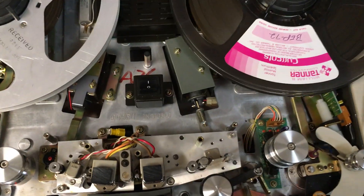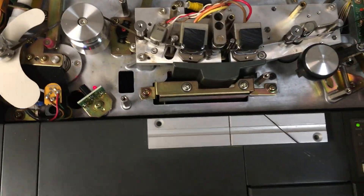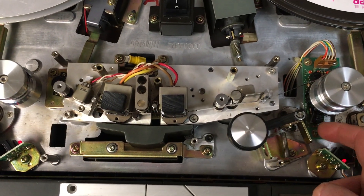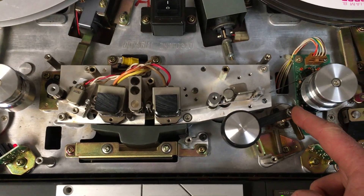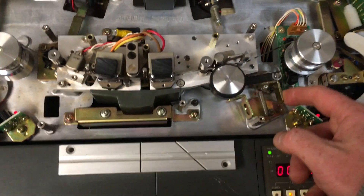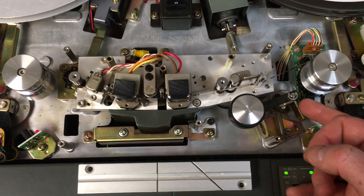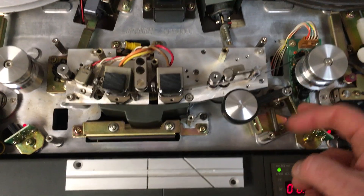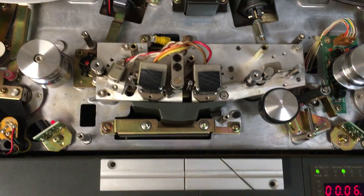The main issue inside was the pinch roller — it's always the shaft that sticks, whatever it's rotating around. It just requires pulling everything off, cleaning with IPA, re-greasing, and putting back together again. So I've got the pinch roller going again.